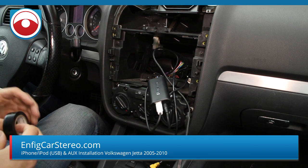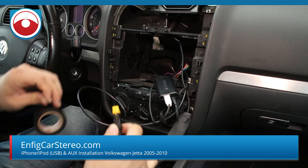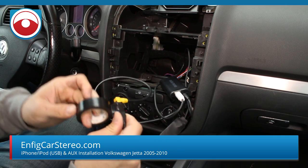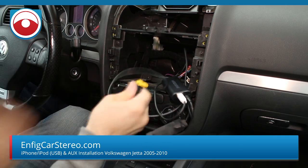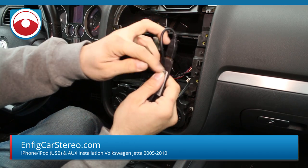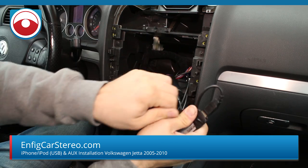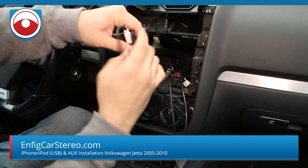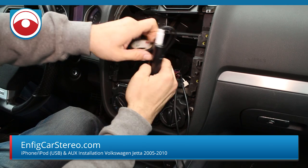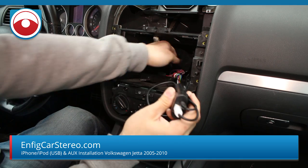Now here are a couple of recommendations to keep your install hassle-free. You don't need it but you could tape the connection for double security. Over here you definitely want zero pressure on the wires — no strain, because strain will break it. Tape this connection so it doesn't unplug while driving. Over here do the same — very little strain — and tape it so that if someone yanks on it or the car's moving around, you don't have any problems.